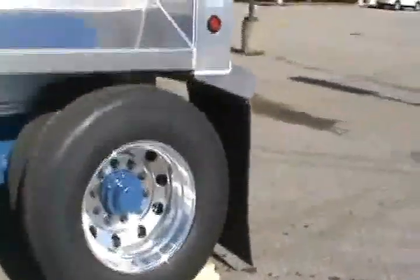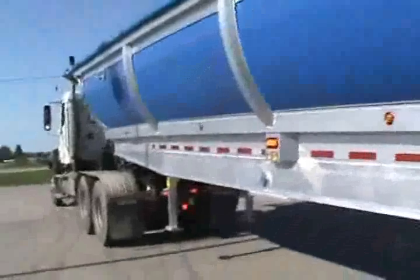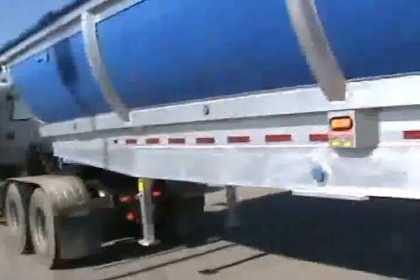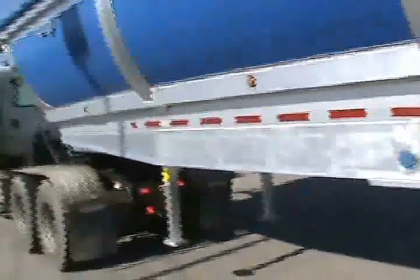Once the light's on, as you can tell right here in this case, it's too unlevel. He'll try to raise the bed. You can see with the light on, the bed won't even attempt to raise. You can hear the truck revving. Because the trailer's empty, if you reach enough pressure it'll start, but when it's loaded it won't. And as long as the light's on, it won't raise.